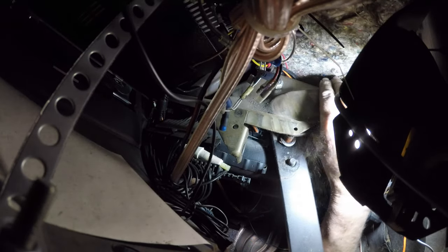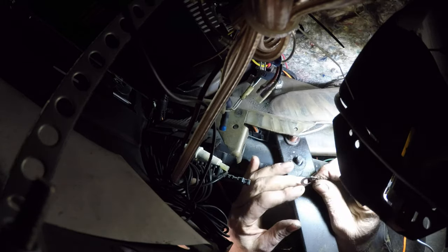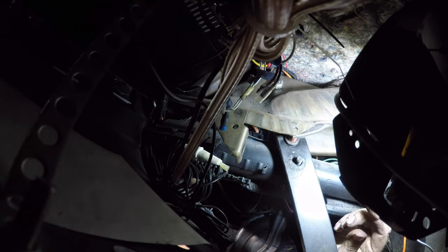There we go - got a little washer on here, make sure that doesn't go anywhere, and then I can just slip this guy off. Now they've got this washer on the back - these are funny little washers that take up space. If there are any gaps in there, you notice that this one is warped. I don't know if the camera picks that up or not, but you don't want to lose it because if you do you'll have extra slop.